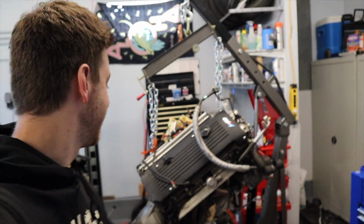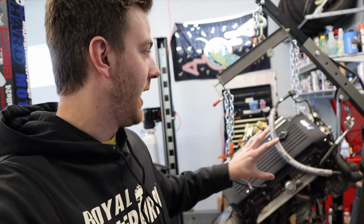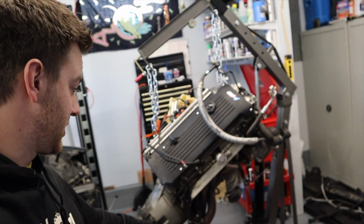It's out, look. So I was going to wait for some help, but I just got too anxious this morning and I started to jack up on it. And when I started to lift up on it, it slid forward like 8 inches. It just came up, and then all of a sudden it went whoosh. And I was like, okay, well, it's ready to come out. And so I just double checked it when it came forward about 8 inches, like I said, and I just double checked everything around it to make sure that nothing was hooked on anything. And the only thing that I saw was the exhaust flanges at the end of the headers. Those were hooked on the subframe.